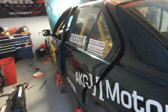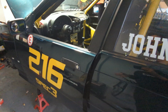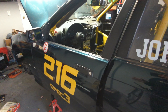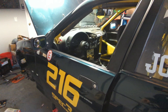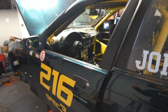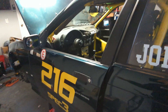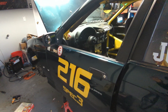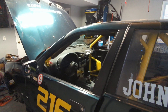As always, when having safety gear as important as this installed in your car, it's highly recommended to use a professional — someone that has made these cages before, ideally someone that has put a cage in a BMW or at least done NASA-regulated cages. Make sure you show them the Spec 3 rules so they don't build something with extra elements that won't be legal. As always with the Spec 3 rules: if it doesn't say you can, then you can't. Good luck in your build and I hope to see you on grid.